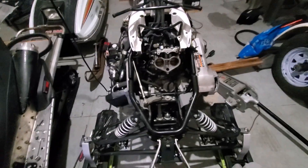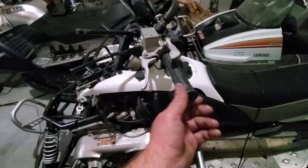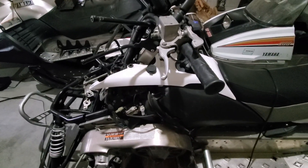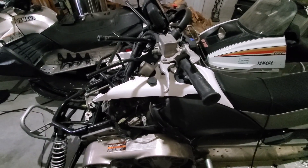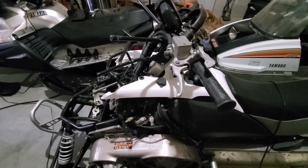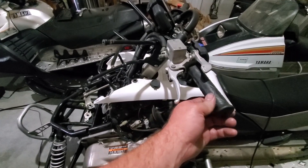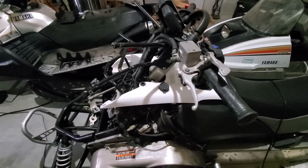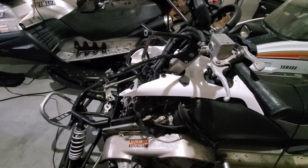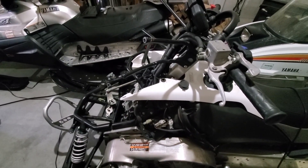So we'll go ahead and show what the after looks like on the handlebars. You can see right here — that's all the play we have. I can look down inside and I can see that's just tie rod ends doing that. There are so many tie rod ends on this that can wear, and if every one of them has even a millimeter of slop — even a few thousandths of an inch — all that adds up at the handlebars and you have quite a bit of slop. But for right now, that's where we're going to stop with the repairs on this, because I think everything else is really in good shape. Maybe down the road if we have another tie rod end that needs replaced we'll do that, but nothing serious.